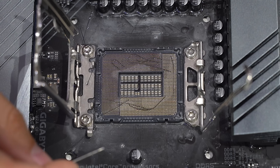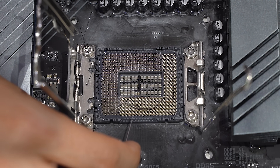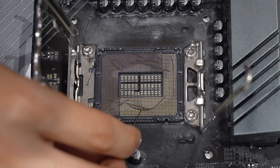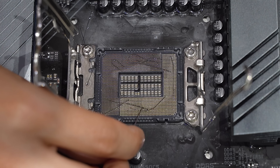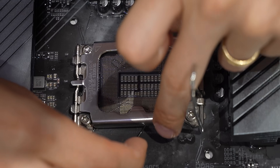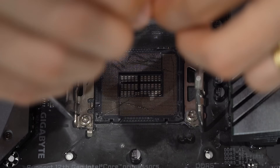And here's an extra tip: I like to use a sewing needle if I need to run between pins in a land grid array or if I need to scoop something out — for example, these little nylon bristles. I just realized I bent a pin doing that because I ripped it out way too quickly.